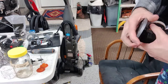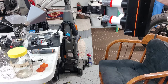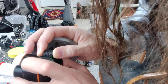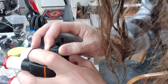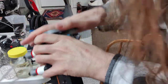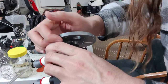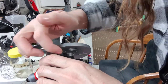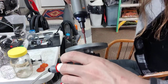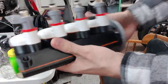Right now I think it's retarded like three teeth. I'm just moving the crankshaft gear while holding the camshaft gear, so right now it is three teeth retarded. I'll put the flywheel back on. I'm also going to be doing a typical adjustment like how a racing camshaft has adjustability — where you have three or four screws and you can rotate the camshaft gear on a disc and then tighten it down — so you can get even more finite adjustability than using teeth like that. Alright, let's go ahead and fire it up.